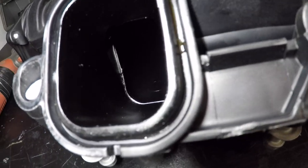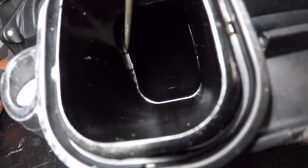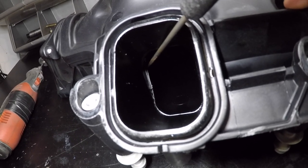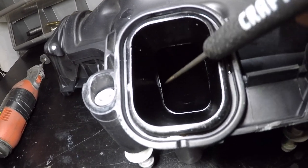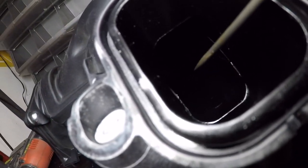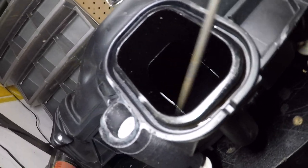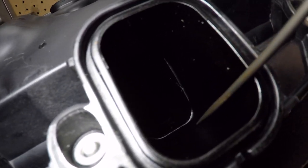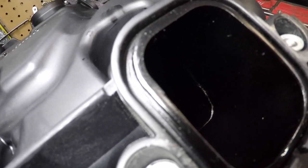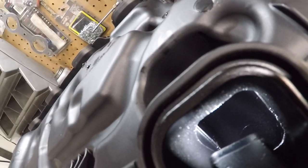Here are the runners. When you see the runners, you see there's a lot of overlapping material - this is flashing material that can be removed. You can remove all this material and increase the volume inside the runner. We're going to remove that flashing and carry it all the way out. There's a little dimple down here that I like to get rid of too. There are steps all around the intake manifold runner that need to be removed, and every runner will be slightly different - some have more overlapping material than others.